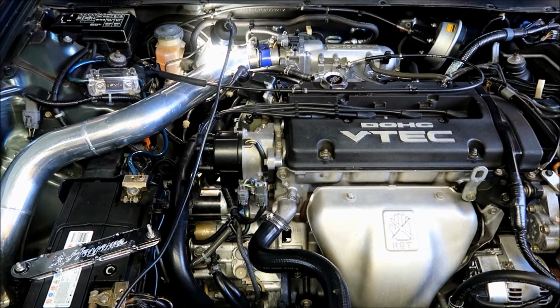If you do not get the coolant off almost before it dries, it's almost impossible to get all these little white dots and marks off your engine bay. It can really make a mess of things. So take my advice, clean it off straight away. If you have to use cold water, just trickle it on very carefully. Don't just throw a whole bucket of cold water on a boiling hot engine. It's not a good idea. Anyway, we're going to get straight into this and try and fix this problem today, and I'm going to show you how I go about it.